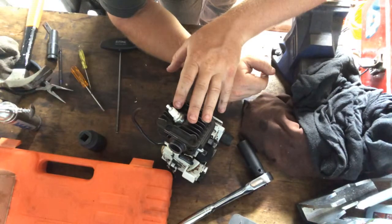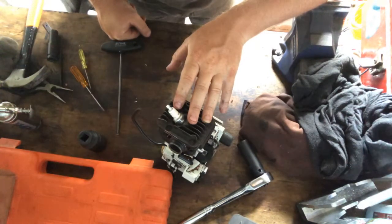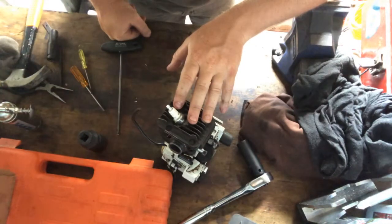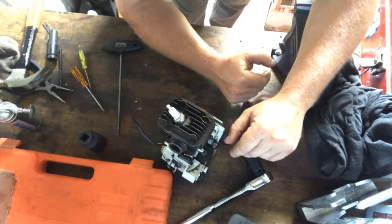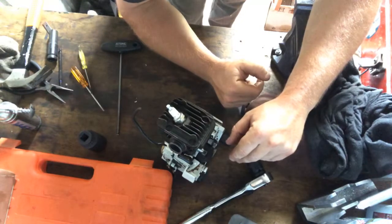So you're probably not going to outdo the capacity of a normal bearing, but with those hybrids, I've seen figures on them being able to stand up to like 300,000 RPM. I don't know how true that is. I can't claim that. I've never tested anything like that, but those are some of the figures I've seen advertised. What I'm trying to say is that the ceramic hybrid bearings are way beyond the capacity of what a saw needs, and they're cooler running. They run cooler, they run smoother, they're actually perfectly round, as opposed to the standard balls, which are not.